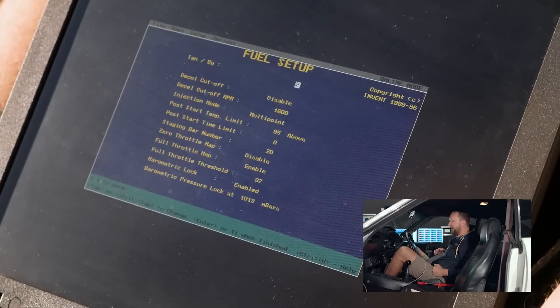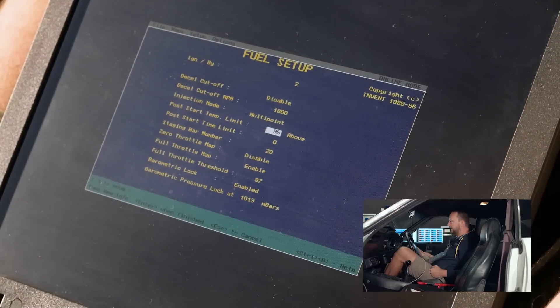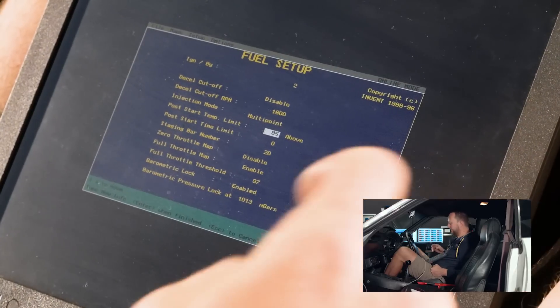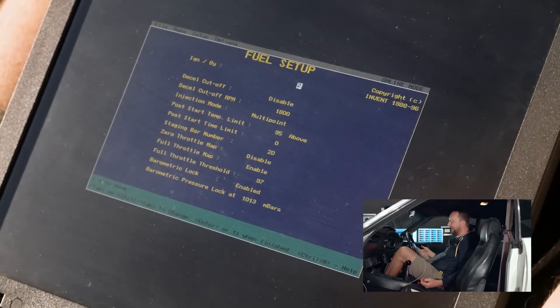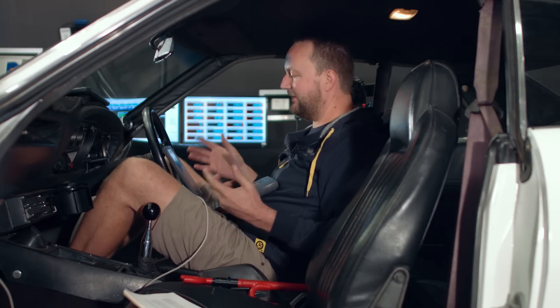If we go to our fuel setup, all of this stuff was our real basic fueling. Remembering that this thing was pretty straightforward — all it did was have four injector outputs, it would fire all the injectors at the same time. That ignition divide-by setting is asking how many injection events you want per ignition event. It was so much more complicated, and the help book didn't really tell us a whole lot. You really needed to know a lot about engine management to get a result here.